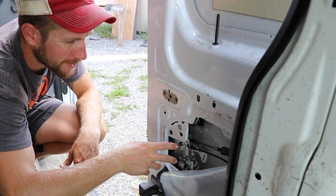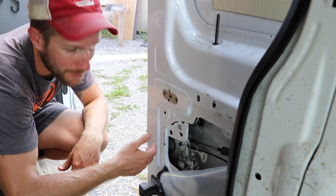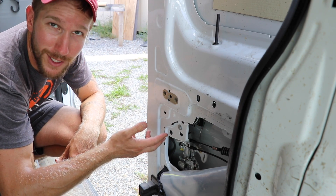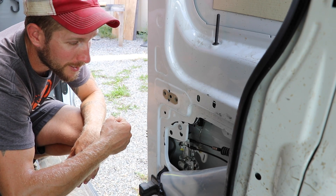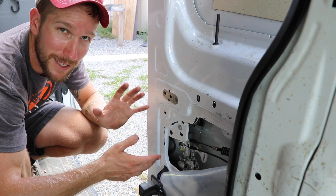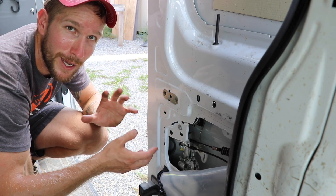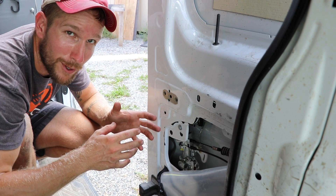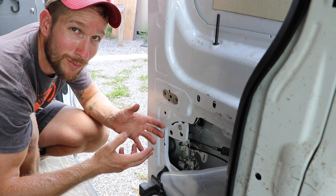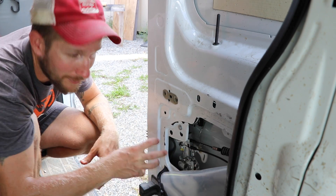The lock or the handle mechanism that wants to come out is right here. You can see this is metal and I can't get through it. There's all the locking mechanism for the door, other handles, electronic locks and sensors that let you know if the door is locked or ajar — it triggers the lights. The trick with this stuff is you don't want to pull anything too hard. You see where the tension is, where things are happening, and you slowly work the puzzle backwards to get the part out that you need, then put it back together hopefully later.